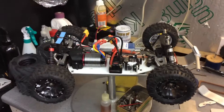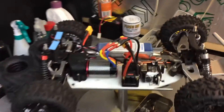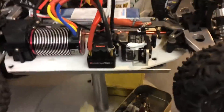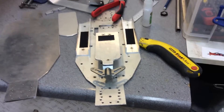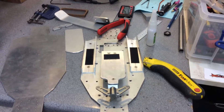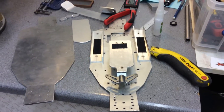Hello there again, just a quick one. I had some chap ask me about my Invictus, which obviously doesn't look like an Invictus anymore. The chassis is aluminium, which I'd done myself. He was asking me about the two batteries. The two batteries thing isn't a good idea because that ain't a big enough car to do 4S — that ripped the gears straight out of the little plastic case. So 4S is not a good idea.